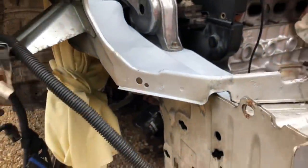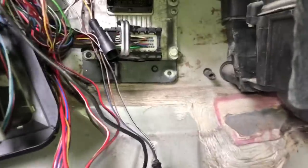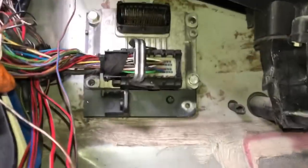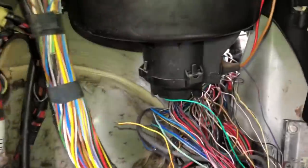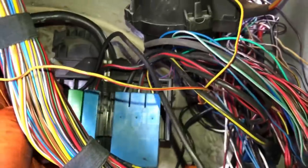The main loom is going to run across the crash bar and then under and around the back. After much deliberation, I've figured out where to put the ECU - folded to the back of the bulkhead in a lovely secure position. I've modified the alloy bracket that comes on the car originally, and it still has the barometric pressure sensor in there as well. I've found a nice little spot for the fuses - drilled a hole in the back so they'll sit there on their plastic hanger, accessible from underneath.